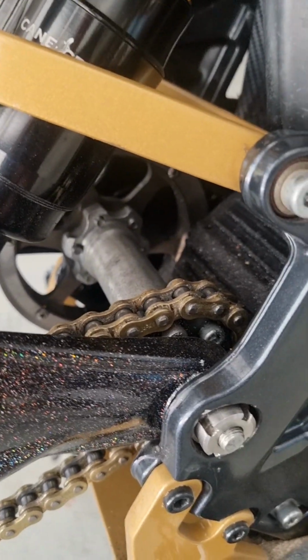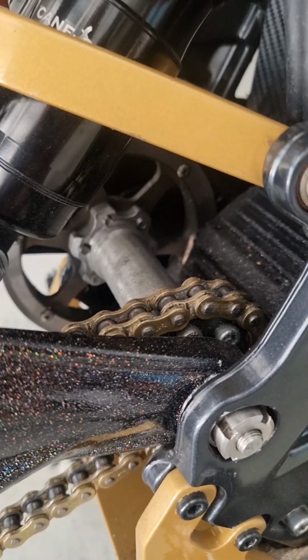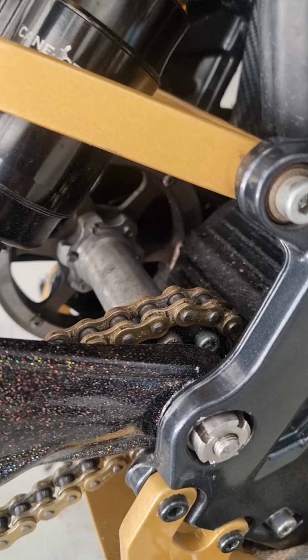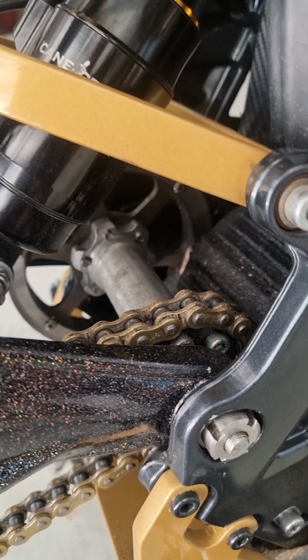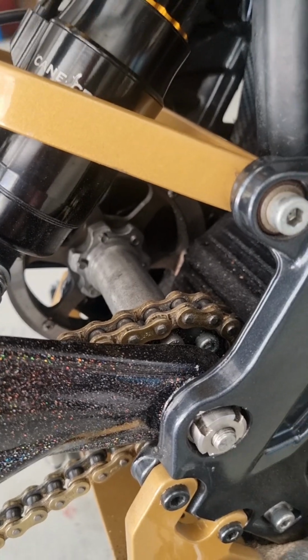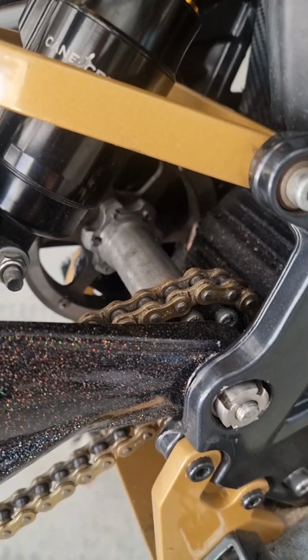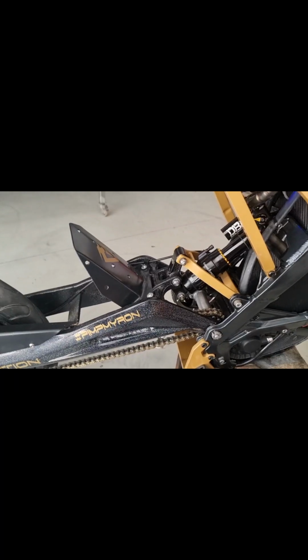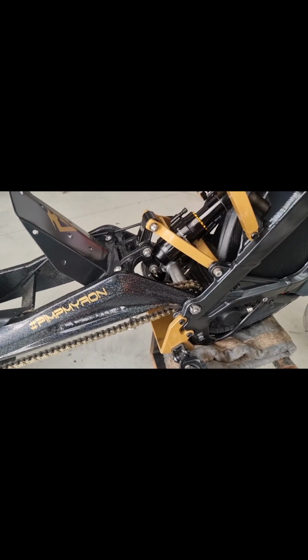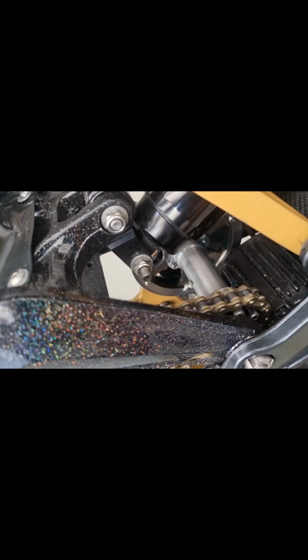So all you've done was compress the cylinder, because you need to have grease ports on the outsides of the bearings so the grease can escape past the bearings, so you actually are replenishing them. Otherwise it's pointless. You're compressing the cylinder and then it's harder on the bearings to run in compressed cylinder situations. So that's it, re-greased now on the custom jackshaft, one piece re-greasable.